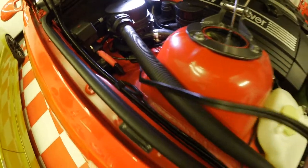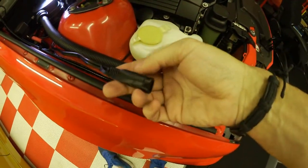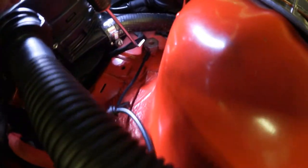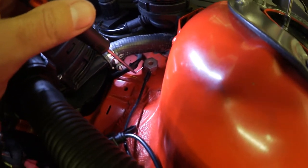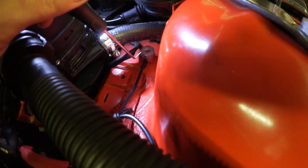I've got the battery tender and that's the plug where you plug it in. Then I've got the negative running right down here to a negative — there's a big nut down there that's connected to the frame, so that's a good place to ground your terminal.